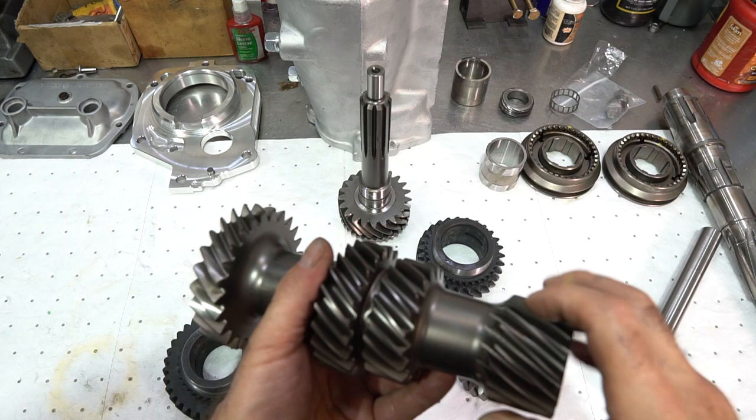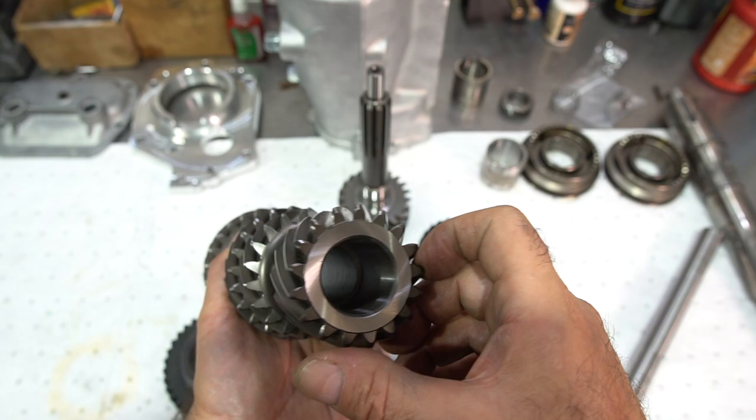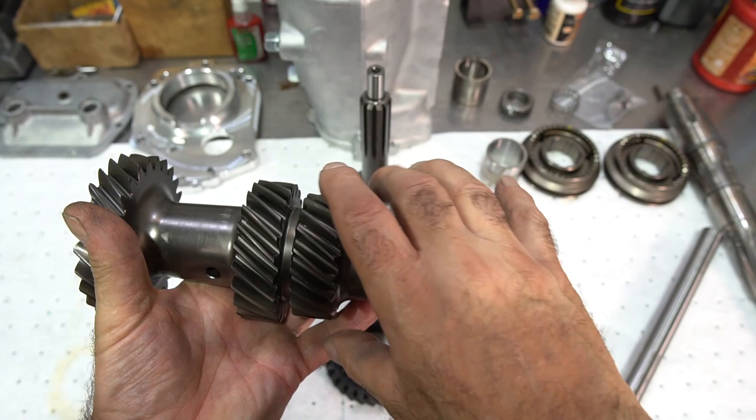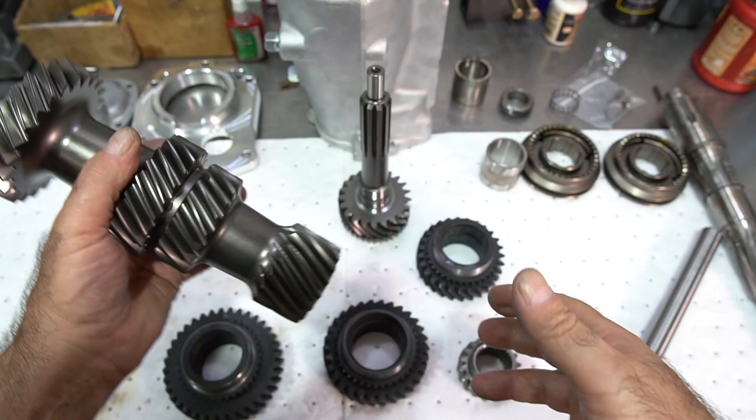The counter gears are usually in pretty good shape. The front ends look like they're ground gearing — you can see the shininess — as opposed to hob gearing. What's also cool is the inside of the gear has a built-in spacer; there's no seam tube in there, which makes it a lot easier to load the needles. It's a beefier design with a little more taper and radius, seems to be a stronger piece, and beautifully machined. I've built many transmissions with these gears and haven't had one break yet.